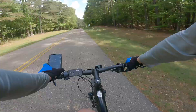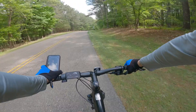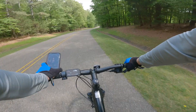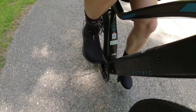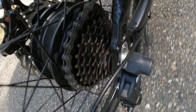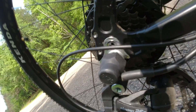The big box suspension fork is usable on these trails, though still a bit noisy, as is the MicroShift 26C — but they get the job done. I've had zero chain drops and no shifting issues. For the most part I stick in the highest gear with periodic throttle-only moments. Performance-wise, I've had this bike at the trails twice and around the city multiple times. My top speed is not quite 20 miles per hour but 18.1 — that's where the motor tends to cut off, whether I'm on flat ground or going downhill.